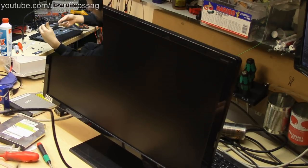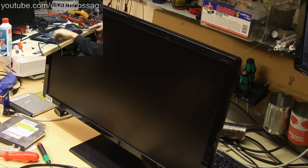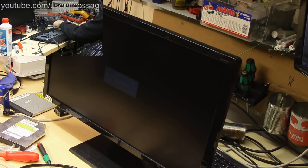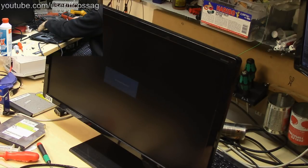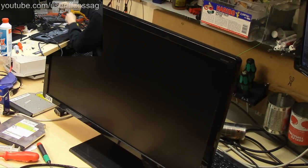The PC should be going beep though, and it isn't, so that's not good. It should also not be giving video, which it isn't, so that's normal. Why it didn't go beep though is bothering me. Maybe we still don't have a good connection in the power cord.